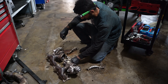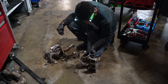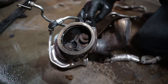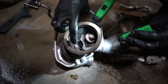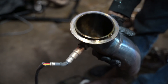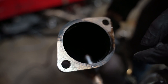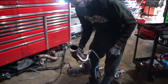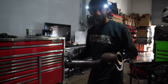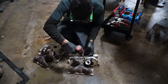These are the high flows — the Pure 800s — working on the oil drains right now. We're going to take off the oil feeds, coolant in and coolant out, and once we do that we can get all the lines cleaned up and prepped for the new pure turbos. Now that we've got this out, let's see what's going on with the failed turbo — it's actually the front one that failed. As you can see it's lightly coated in oil, and you can see oil coming out of the center section past the wheel. In the downpipe it's all lightly coated in golden oil all the way to the end — that's not normal, not supposed to be like that. That turbo didn't have a good day, and now it's time to make it right with pure turbos.